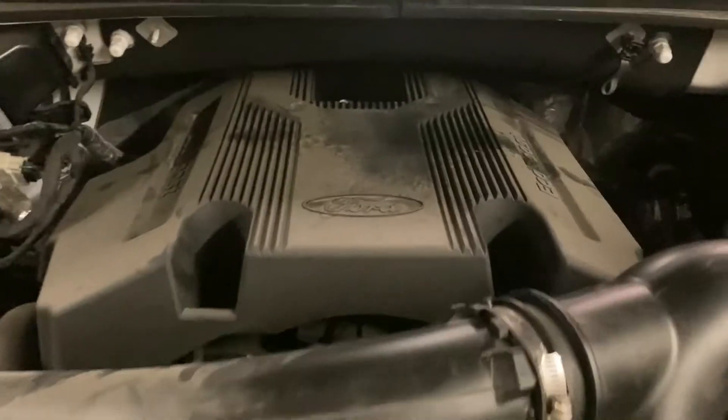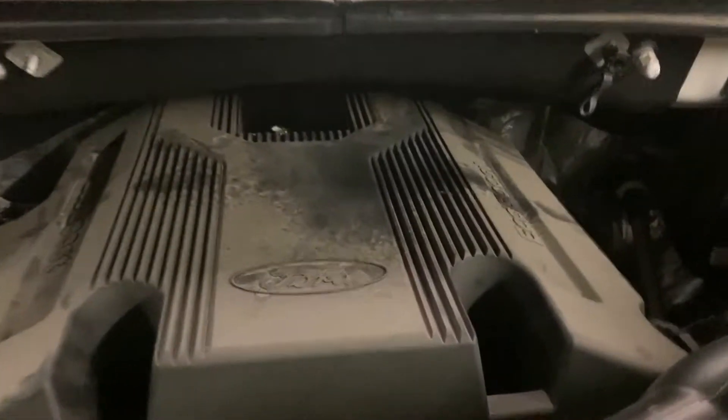The first part I'm going to do is remove the engine cover. It's two 10-millimeter bolts inside there, and remove the oil cap, and the cover should just pull right off. So I've got my 10-millimeter and I'm going to remove those two bolts. After those two nuts were removed and the oil cap, just pull the engine cover straight off. And now we can see the direct intake manifold.